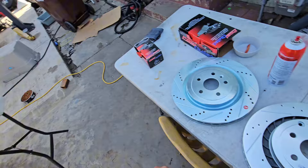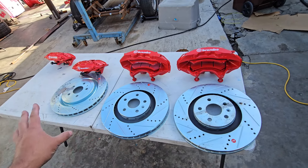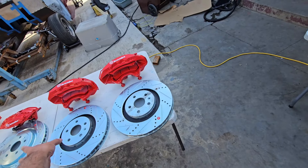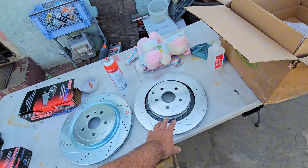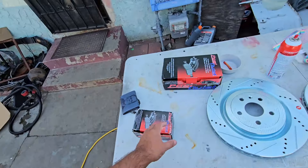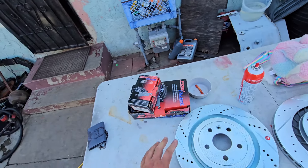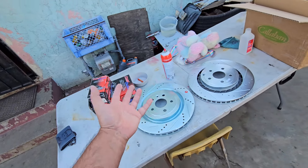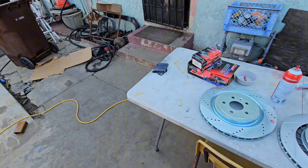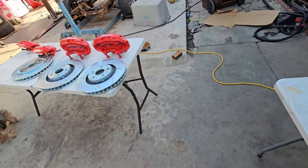You need the SS sedan rear two rotors and the Cadillac front two rotors. It costs more to buy them separately than just buying the package — back in the day I bought these for around two hundred dollars, but separately it's more expensive. The brake pad I use on all the cars is a Posi-Quiet ceramic. They do not make any brake dust, they smell a little burnt, but your wheel stays clean and those pads last forever.